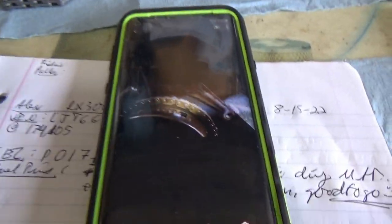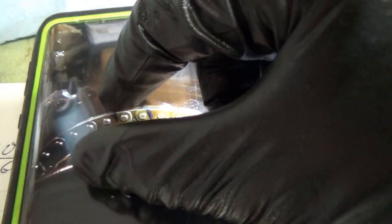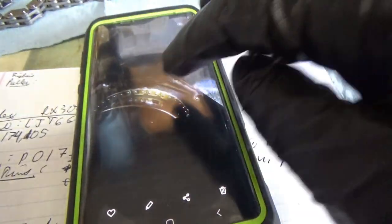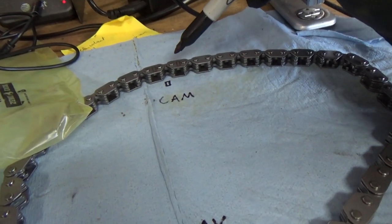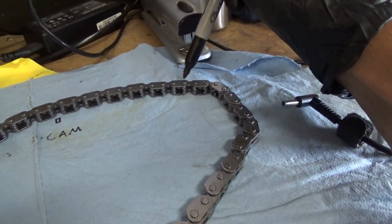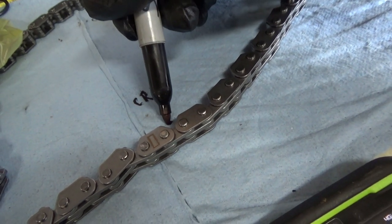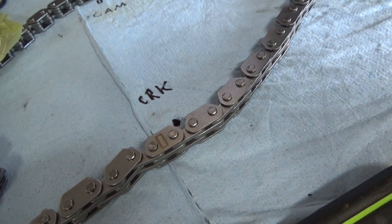Let's count that on the new chain. I took a couple pictures with my phone for reference. This one is of the cam — that mark is in between two links. That's exactly what the new chain shows. The next picture is the crank — you can see that dot right there is in between two links, and we have exactly 18 links between the two marks on the new chain as well. Counting 1 through 18 on the new chain: right now as the truck sits, this dot is right here, but it's supposed to be one tooth over — right there.